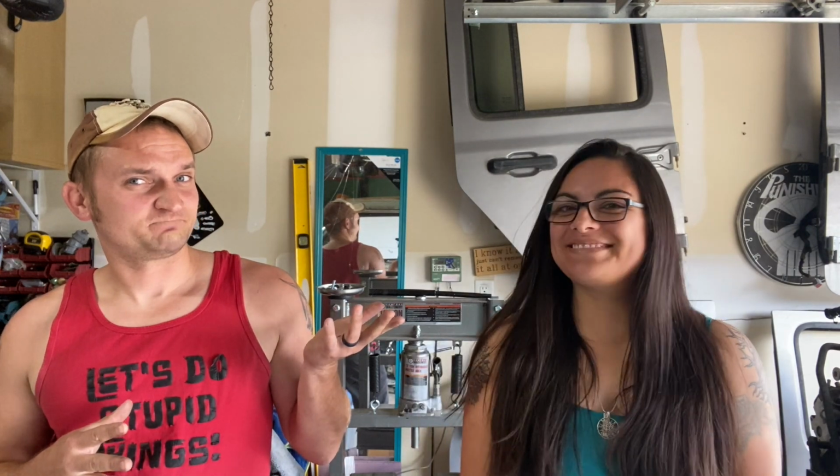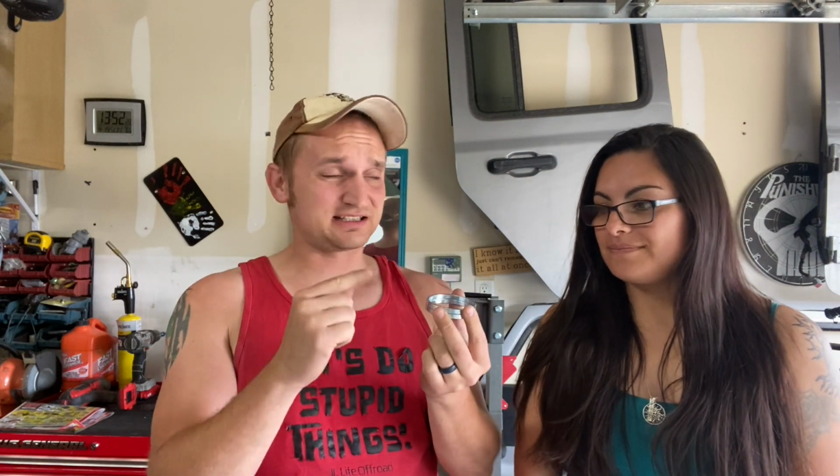Again, these are maintenance free. They're self-lubing. They have a self-wiping seal, so you're not getting dirt and grime up inside of the shaft. They make a cool little sound when they're compressing when you first get them. Cool sounds. And they are adjustable. They come with spacer rings that you can use to help adjust the speed bump itself if you don't want to adjust the bump stop.